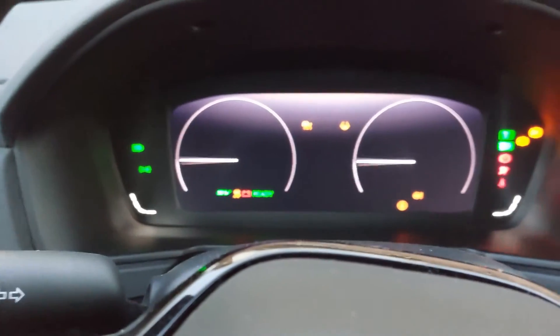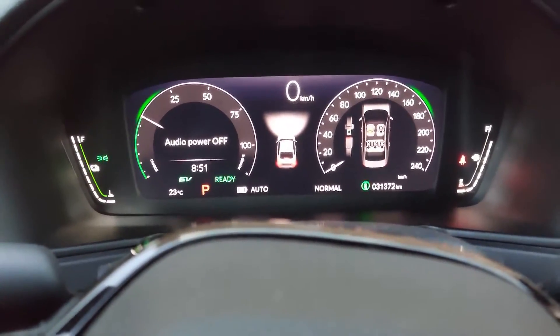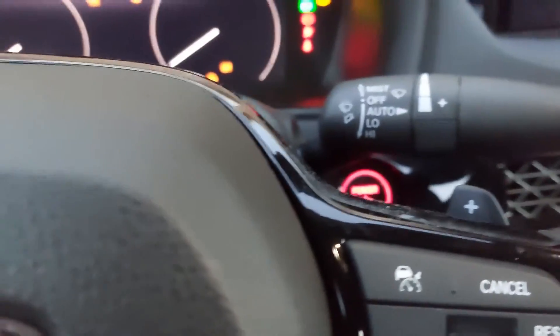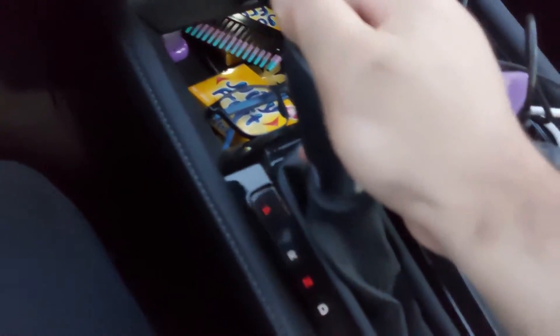Let me run through it one last time. Hit the power button twice, hit the accelerator twice all the way down — one, two — then hold down on the brake pedal. Shift into neutral, let go of the brake pedal, and hit the accelerator twice — one, two. Make sure you are pressing the accelerator all the way down.